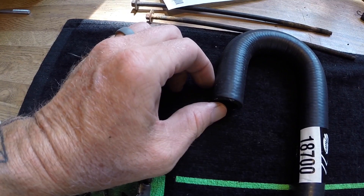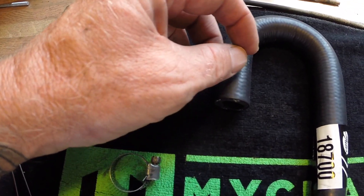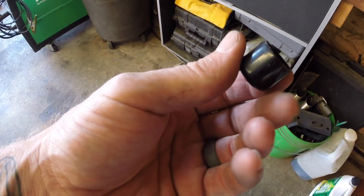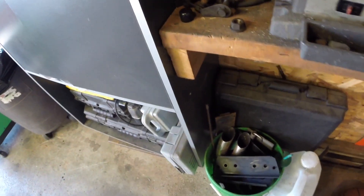I don't want that to sit up too high, so I'm going to trim just a little bit — maybe about an inch — so it sits down just a little bit lower in the engine compartment. I was able to clean everything off with the port uncovered using some plastic caps. I just set one over there — it's got oil and crap all over it from being on that crankcase breather. Anyway, getting back to what I need to do is put these two ends together, cut that off, and get this on the truck.